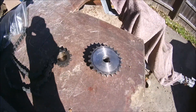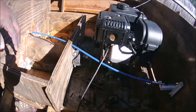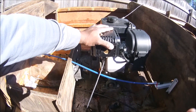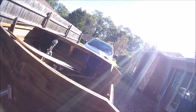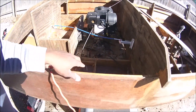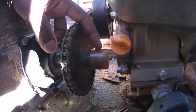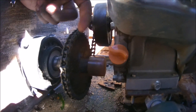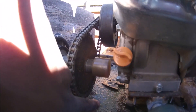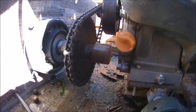Someone else reminded me that this little motor right here — this little teacup motor — might not have enough horsepower to push that, but like I said, it's only one way to find out and that's what we're about to do. I can't take this off without taking this off, and this doesn't thread on — it's just glassed on there. So what I do is turn the motor on, turn the throttle up, let it rotate, and take a piece of sandpaper or a file and hold it right here and sand this bad boy down.